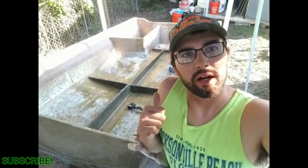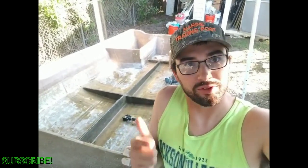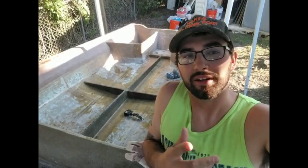So I'm going to get that sanded down, get that cleaned up, and I'm going to get my foam board out from behind the shed and start templating the floor out, then get it transferred onto my Divinacell and get it cut up, glassed up, and then bonded into the boat. So stay tuned and we'll get to it.